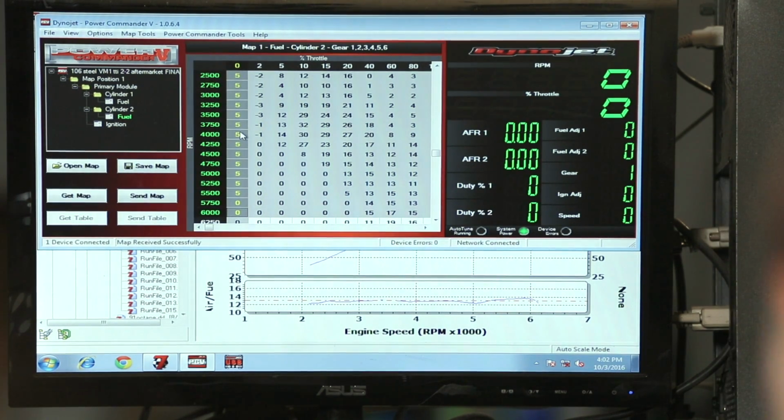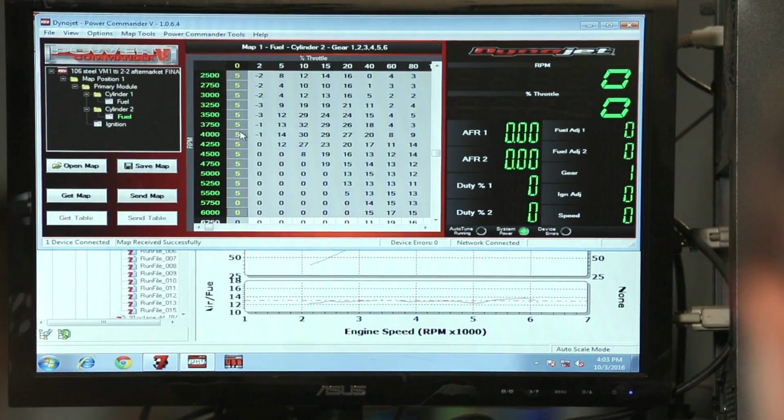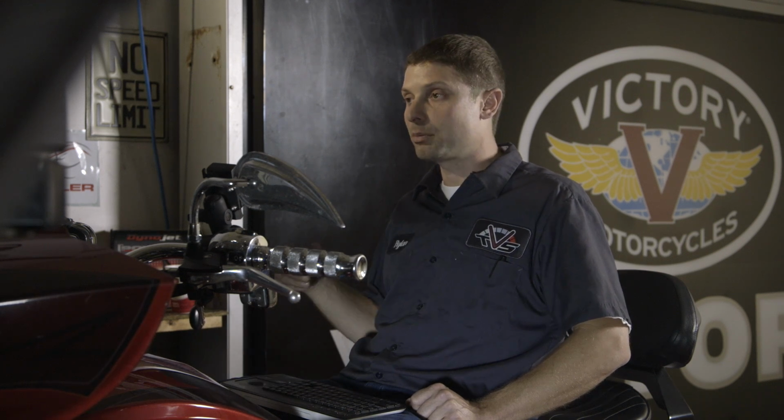And let's say, like in this case, it's a positive 5. If I was trying stuff out, I'd try swapping that to a negative 5 on both cylinders and see how negative 5 affected it. And if it was better at negative 5, I might try negative 20 and see where that gets me. Or if it was worse, then maybe I'd try a large positive number like positive 20 and see where that got me.